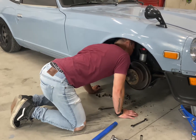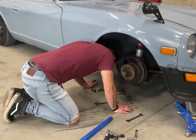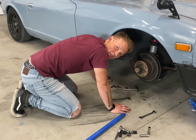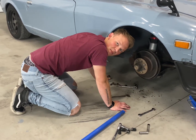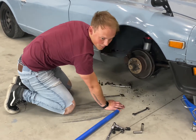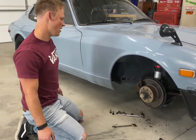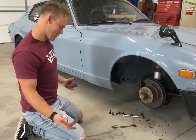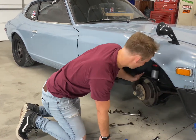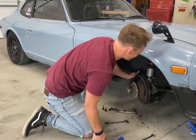Would you like to explain what you just got off? The bolts for the steering knuckle — they're a pain in the rear. I recommend taking those ones off first because it moves the whole strut assembly and steering rack while you're doing it. Even if you lock the steering wheel and you've already taken everything else off, it just rotates the strut assembly itself. So do those ones first because now we're moving freely as far as the strut assembly goes.